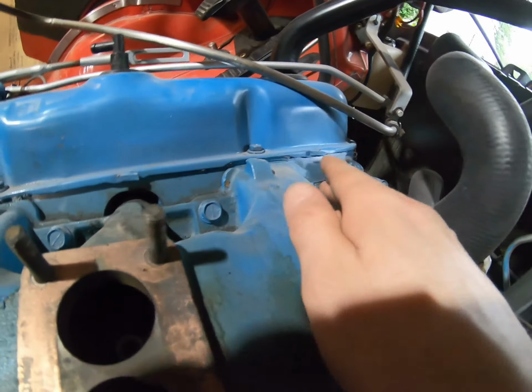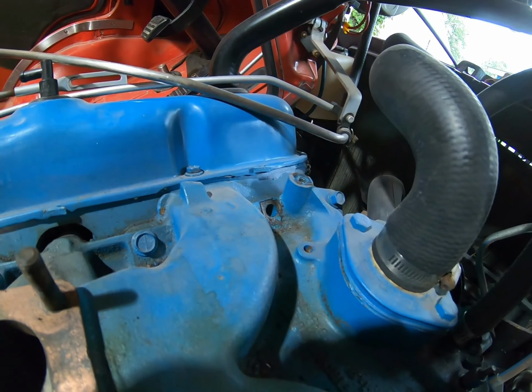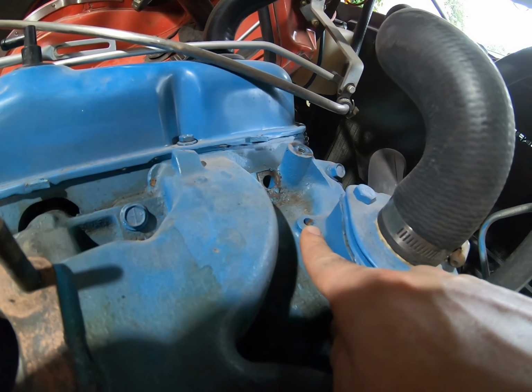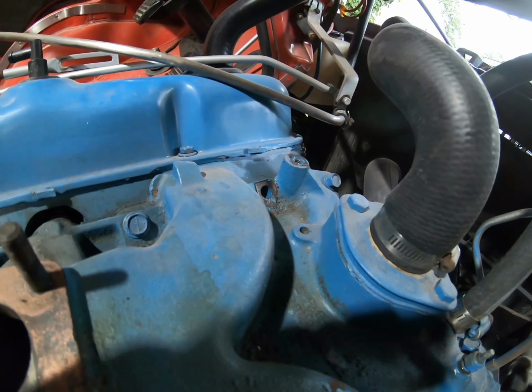And the throttle return bracket that put here, it's going to need a little bit of tweaking to fit on the manifold because there's a big stump right here that keeps it from working as it would have here. See, this hole is a little pilot hole, so it keeps it from turning. Well, on the intake manifold we're going to put on here, that does not exist.